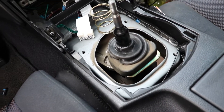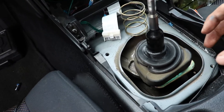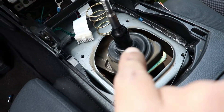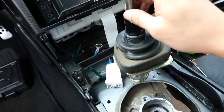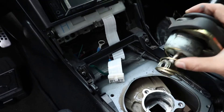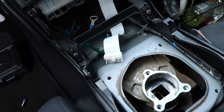Note for anybody doing this: leave at least one of those three bolts in place. What I did was take all three off, then went into the car and figured out what was holding it on. There's a 12-millimeter head bolt that comes in from the driver's side end for left-hand drive vehicles. Once you undo that, this pops out because there's a spring inside. It sits like that inside the transmission, so once you undo it, it just kind of pops out a little bit.